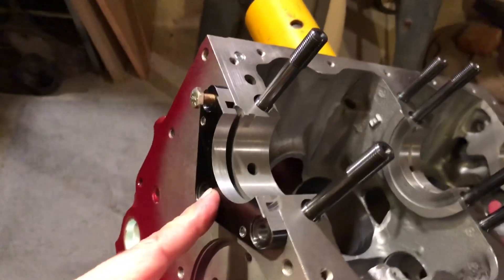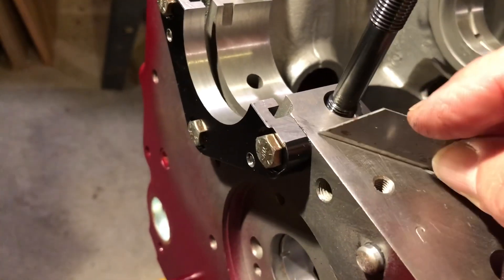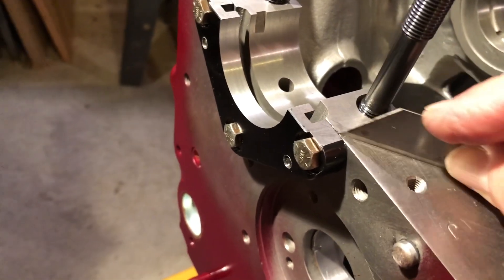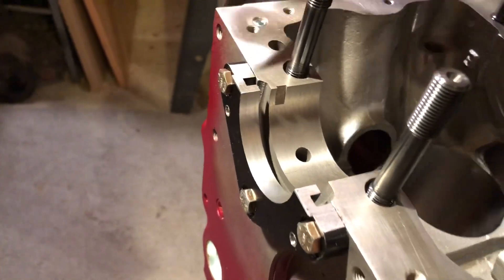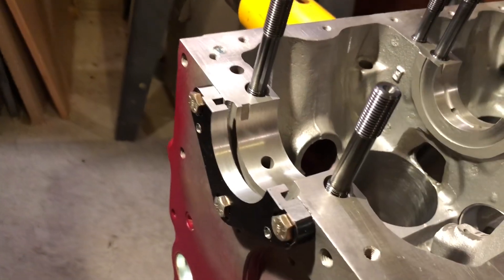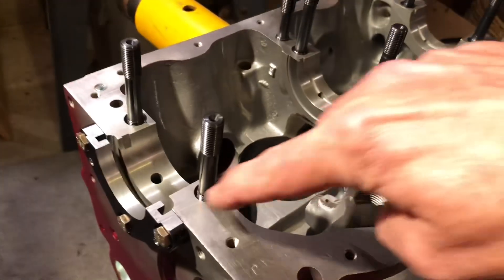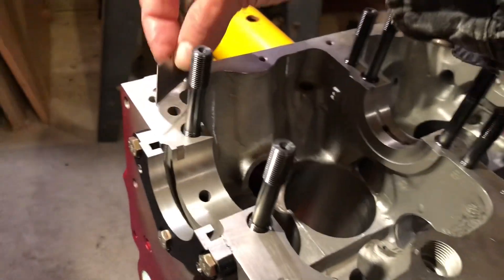We'll carefully get this assembled, sneak up the torques. I'll probably use a little bit of Loctite on these screws. I like to use a razor blade to check for the surface being what's called proud - you do not want this cap, this little upper piece, sticking up at all. If you go to torque the main bearing cap over this and it's sticking up kittywampus, you're going to have issues getting the torque down, you're going to push that away and mess up your seal arrangement. This is the critical bit: that this saddle lines up perfectly with the main bearing, and that these ends here are absolutely in line, flush with the block.